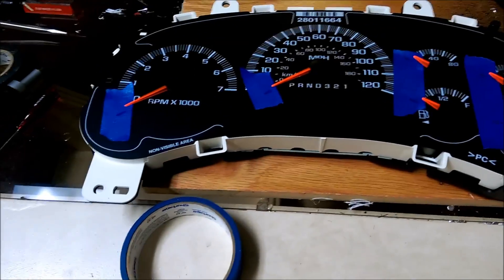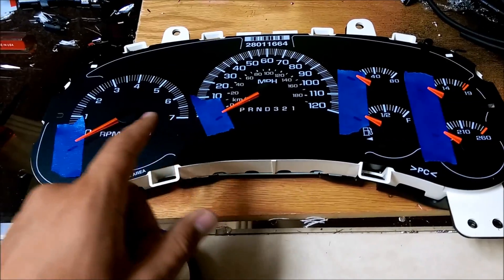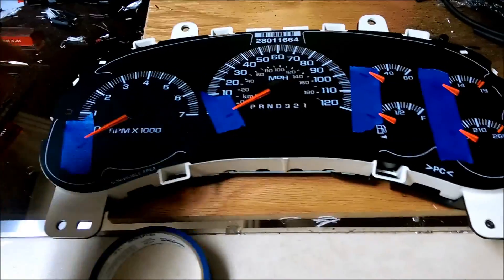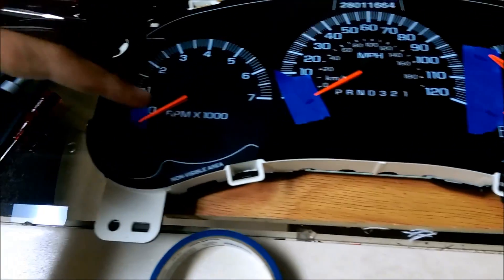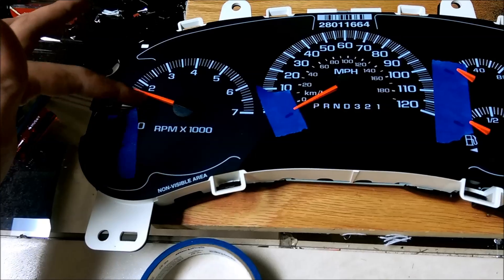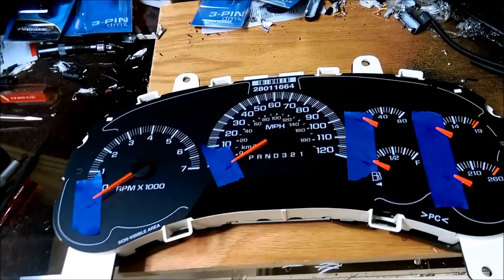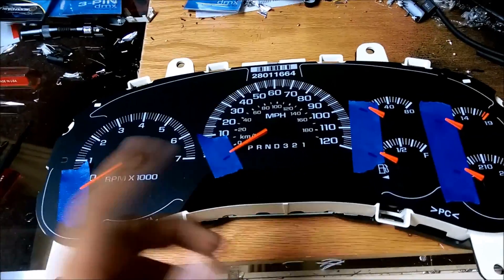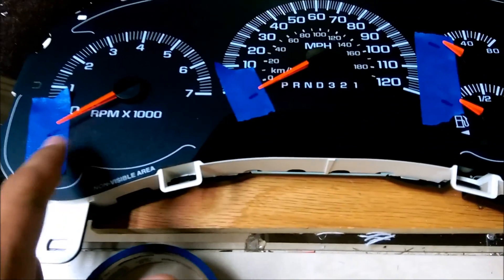If you're also going to be changing your stepper motors while you're doing the LEDs: you'll know if a motor is bad, but if it's smooth to move it's good to go. If you have one that's really notchy or doesn't even make a noise, then it's obviously busted.